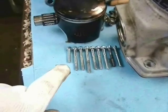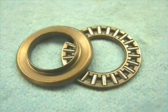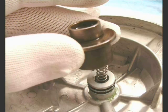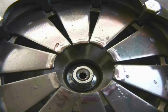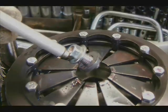The small clutch cover, when you take it off, has the slave piston built into the back of it. There are two little parts on that piston: the washer piece I call the thrust washer, and then the bearing. You can see the piston, the bearing, and the thrust washer. Later in the video we'll talk about these more in depth, but just keep track of these parts. In the center of the clutch is a big bolt and a thick washer or bushing.